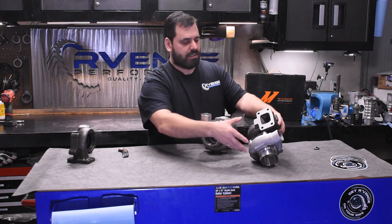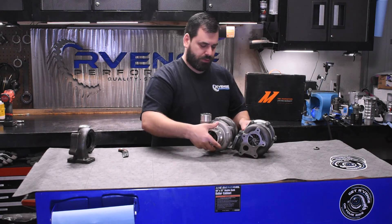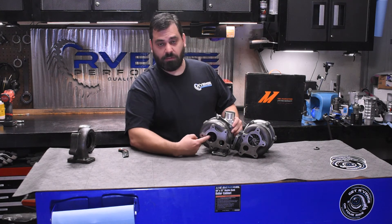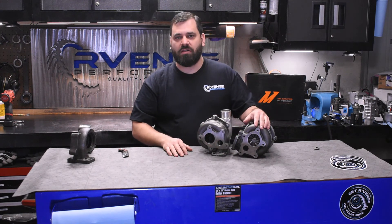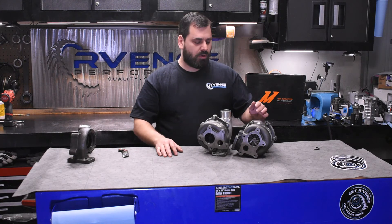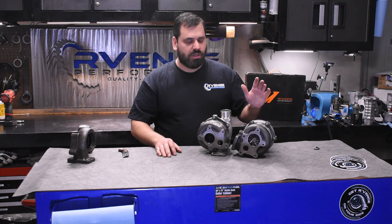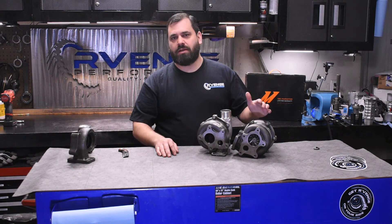Our T3 inlet is exactly the same, and you should be able to see here how much bigger our turbine wheel is. This is our GT28 wheel and this is our GT30 wheel. Traditionally, the GT30 wheel has been thought of as being pretty laggy with only a 3.0 liter — 1.5 liters per bank — powering it. With our stroker, that's basically 1.7 liters per bank, which helps. Also, with the high stall torque converter, we should be getting right into the meat of this turbo right off the launch, stalling past where it would be sluggish on a manual setup.